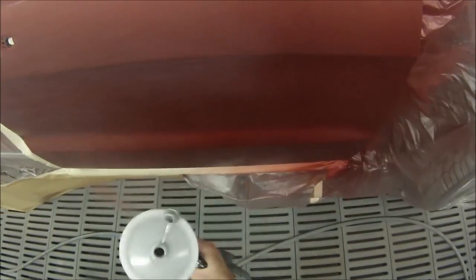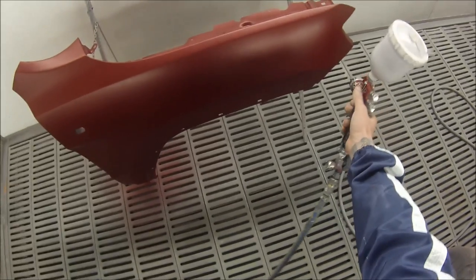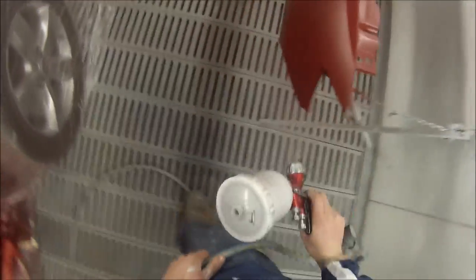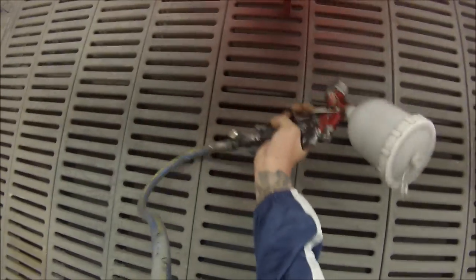This is the top coat colour I'm putting on now. I went out for five minutes — I remember having a smoke going between coats on this one — went out and had something to eat, and then came back in. By that time it's dried down. We're only painting this bumper bar for the sake of the colour blend as well — the only real damage was the fender, which we ended up putting a brand new fender on. Starting to do the blend now. This colour is pretty dark — dark enough that I decided I didn't need any blending clear on it; I'm just blending it out naturally straight over the dry panel, and it's blended out nicely. Any dark colours you don't need blending clear. If you watch my other vids on lighter and metallic colours, I use a blending clear — but not necessarily on a colour like this.